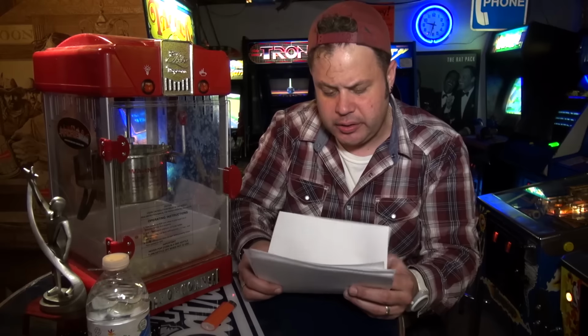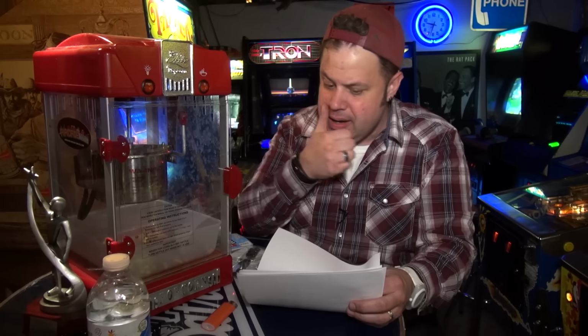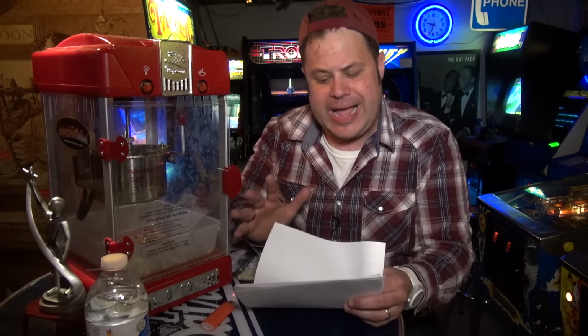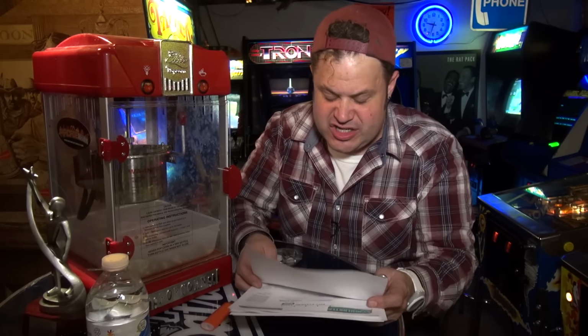And by the way, the one you want, the bulb itself is white. And the black light has like a black light filament. So the tube itself is not colored. And Tron has a white black light and a normal black light, if I remember correctly. But Asteroids Deluxe should be just the normal plain old black light, which is a /BL light. So it's F15 T8/BL. You can buy those online. I usually go to Top Bulb.